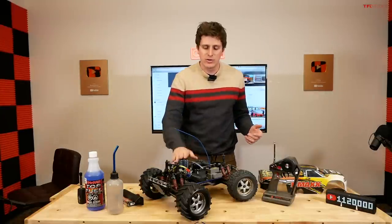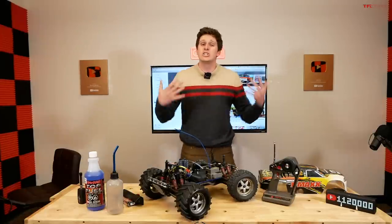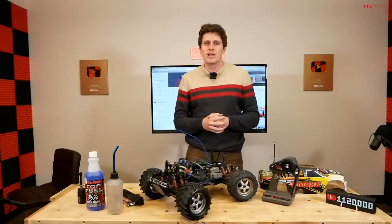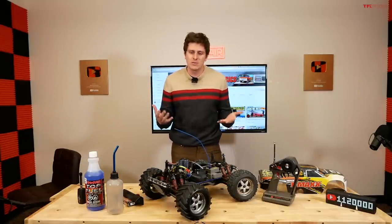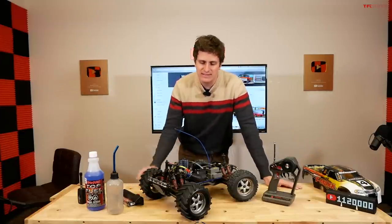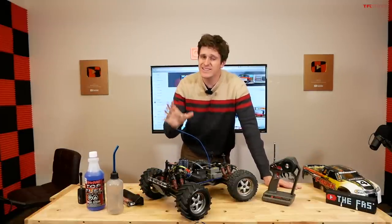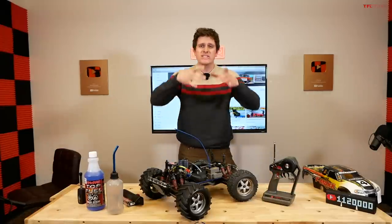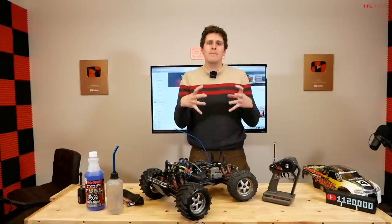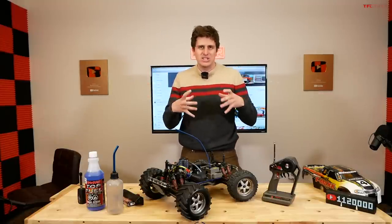This engine was frozen solid, so I had to get a little bit creative. Now, what I should have done would have been to pull the engine, pull off the backing plate, and see what was going on, but I had a pretty good idea of exactly what was going on. I fear all those years ago, when I shut this engine off for the last time, the piston was probably at top dead center, and as I understand it, the bore of these engines is tapered toward the top, and as it cooled down, it shrunk around that piston, and then add to that 8-9 years of sitting, and it was all just jammed up, stuck together.